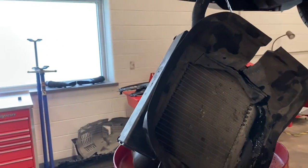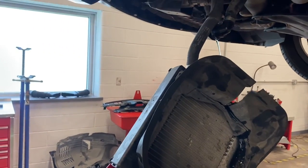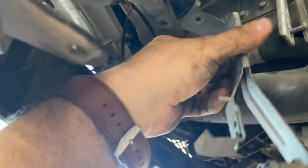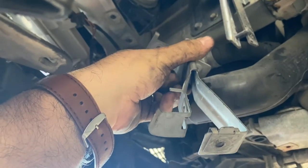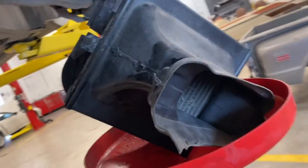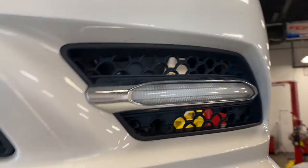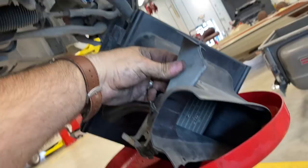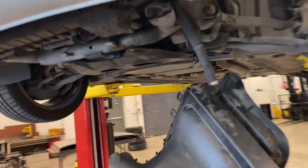As you can see, that's the heat exchanger and it's not capped off, so it's just kind of leaking out from the bottom hose. One of the issues I ran into was somewhere up here you're going to find there is a T bracket that goes right over there. What it does is kind of holds the liner down and a couple of different components. You actually have to remove this bracket in order to actually get the whole shroud out. The shroud actually grabs air from the front part of the bumper, but when this shroud is up it is actually blocking the shroud from coming out. When you remove this T bracket with these two 10mm bolts that are holding it together, you're going to notice that the shroud is going to come out easier.